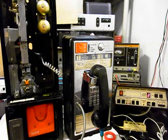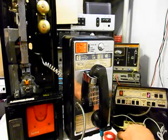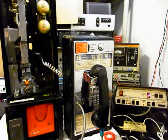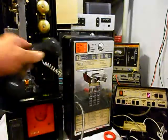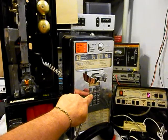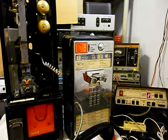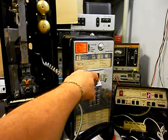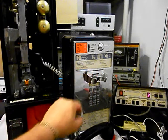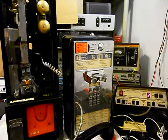Now that we know that this unit is ringing in on a ring cycle, it's dialing out, and we have transmit and receive. We can push this button on the switch box — that gives us a line out, totally takes the analyzer out of the situation — and we can call the time and temperature number. Go ahead and give you some dial tone and we can make that call. We can go ahead and hang our unit up. We can give you some dial tone and we'll call my number, and it'll be busy. We'll make that call. We can hang our handset up.